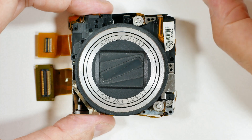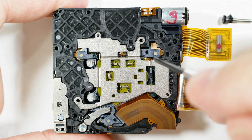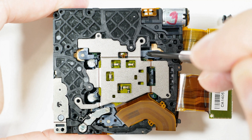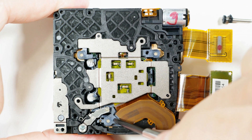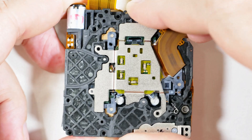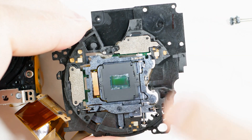This is the lens, obviously. This little jack screw fell out of it — my guess is it's what extends the lens. There are screws on the back, so let's start by removing those screws and see what they reveal. I've removed all the screws, about six of them. Something I noticed here is you can see this moving in there — I think that is the automatic image stabilization, where the sensor is floating on this device and it helps smooth any shakiness in the camera. That's pretty cool. I've got this back loosened.